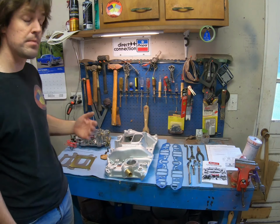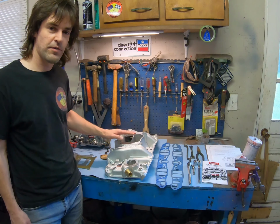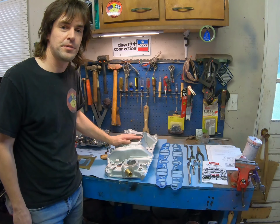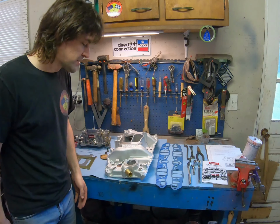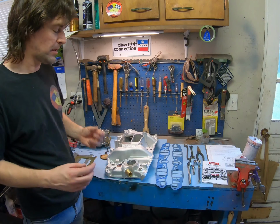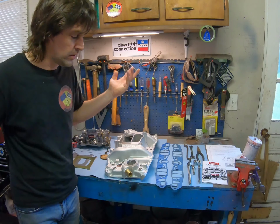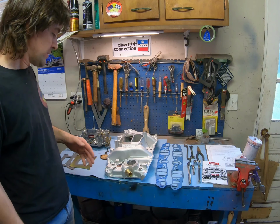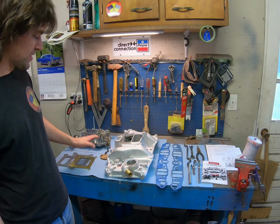2-barrel carburetor, which I rebuilt, but I think there was a little bit of wear in the pivot shaft for the butterflies down the bottom. As we sprayed carb cleaner on there, trying to find a vacuum leak, we found it, and the RPM raised significantly and we couldn't get that worked out. So I think as we were driving it, it was probably doing okay for a while, but then either a spot broke free or wore, I don't know, and couldn't get it to run worth anything after that. So we decided we might as well move up for this and get this going.